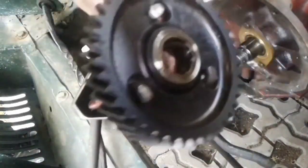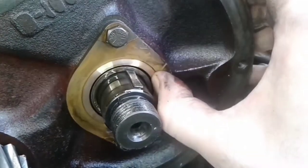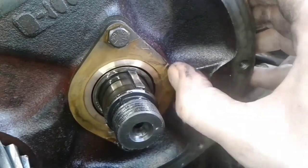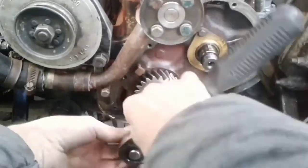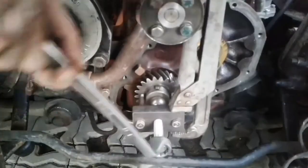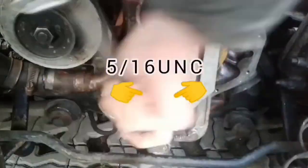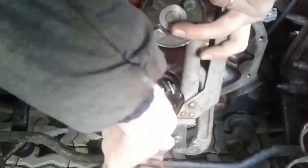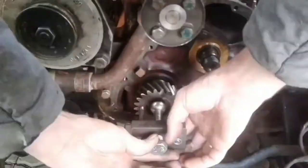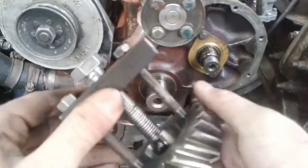This is the original fiber gear from Bosch. We see that the bronze plate is very worn out. Also, the bronze thrust plate broke in two places. Remove the crankshaft gear also by using a special puller. The original crankshaft gear has two special holes with a 5/16-inch thread for the puller. Well, dear friends, we have removed the gears.